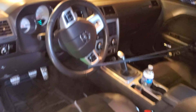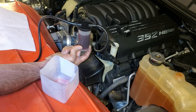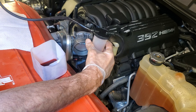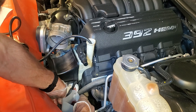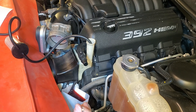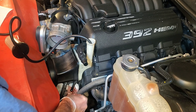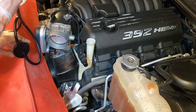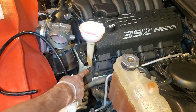I've got a bungee keeping the system from moving and holding it at the far left extreme. Now we can pull all the fluid out of the reservoir. We don't want to move the steering wheel while the reservoir is empty — we don't want to introduce air into the system. So I'm going to back off the clamp, and yes, this is a foam ear plug. I'm going to compress it and stick it in that return tube so that we can fill the reservoir with fresh fluid. If you keep the reservoir filled with fresh fluid while turning the rack back and forth, it will force the system to pull in only fresh fluid and push only old fluid out of the return line. I've put an extension on the return line which I'm running into a little catch bucket.